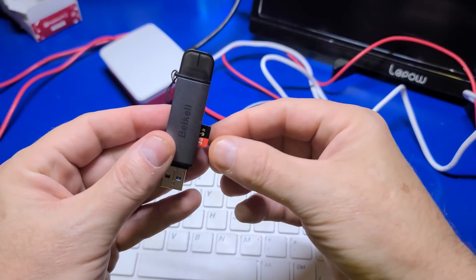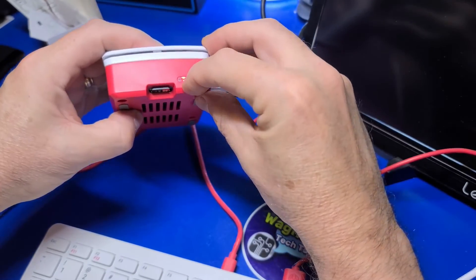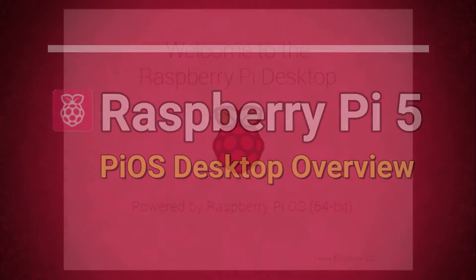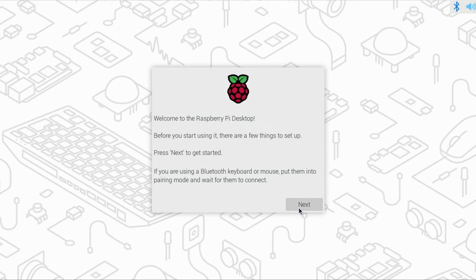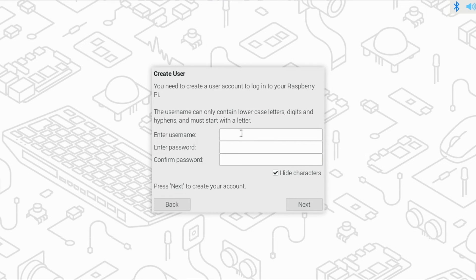Moving back to the Pi 5, we can remove the micro SD card from our adapter. With the power off — red LED on the Pi 5 — insert the micro SD card into the slot and press the power button. After powering on the Pi 5 with the Pi OS Desktop micro SD inserted, a welcome wizard will step you through getting everything ready. One thing to point out: even though we set up the Wi-Fi and time zone settings prior to imaging Pi OS Desktop, the wizard still prompted me for this information. Just click the Next button to get started. If prompted, select your time zone, then select Use English Language and click Next. You'll then be prompted to enter a username and password — enter the username you want to use and enter your password twice, making sure you'll remember it or write it down.